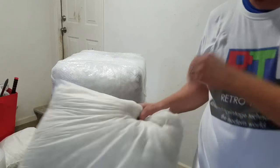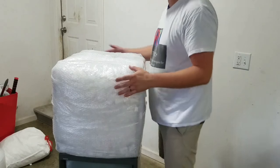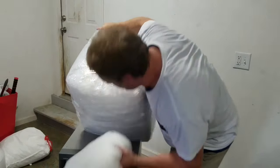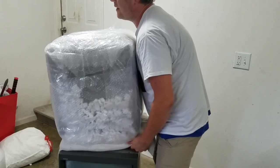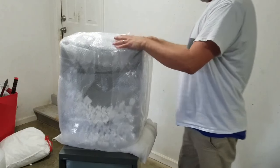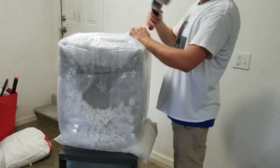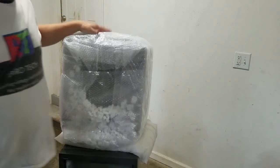The next step: I've got a pillow here, just a standard pillow. I need to move this screen onto its face. What I like to do is put it on the pillow rather than just putting the face of the screen directly on the surface. You've got to make sure you don't have it too crooked so it doesn't fall. It is safe to put CRTs face down like that.